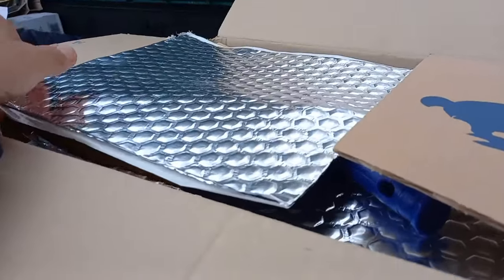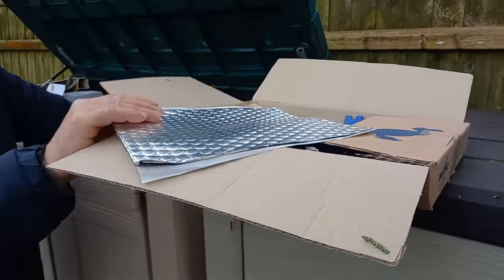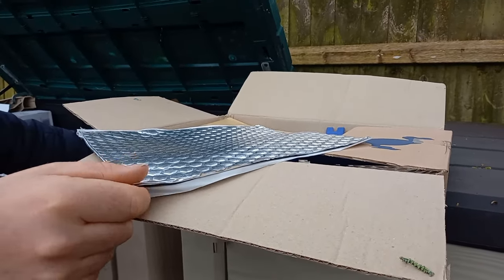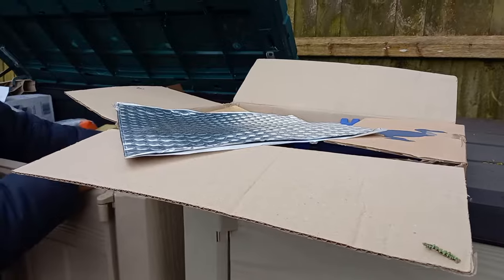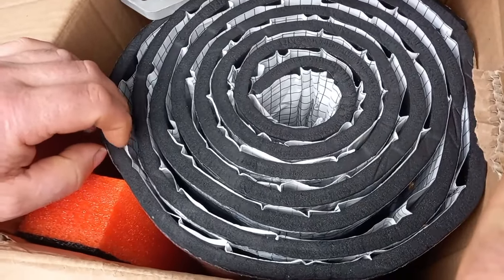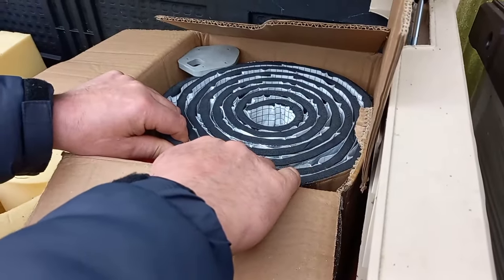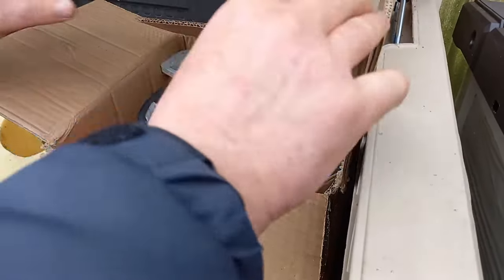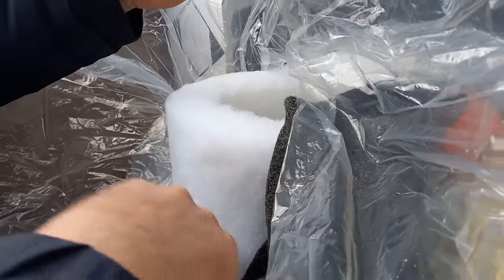So this is the sound deadening — that's the Dead Mat. It's like bitumen on the back. Yeah, it's a bit like tremastic stuff. You warm it up with a hair dryer or heat gun before you put it on, so it makes it a little bit tackier and nicer to mould. Then you warm the panel up a little bit as well. This insulation and sound deadening just literally sticks to the foil on that, quite close together with no gaps. Because that stuff is like a metre wide, you can cut it to fit exactly where you want it, and it cuts easily with scissors. There's wadding in there as well — that's just insulation that doesn't give you any sound deadening. And then the carpet goes on top of that.